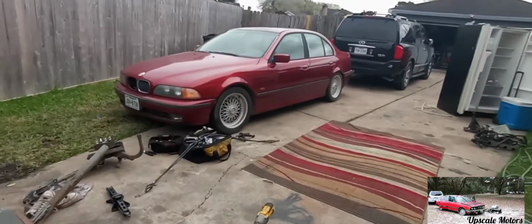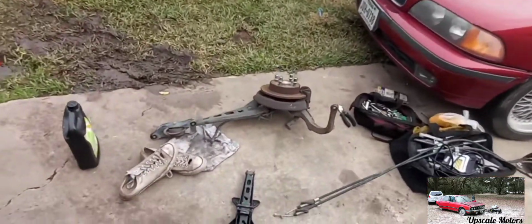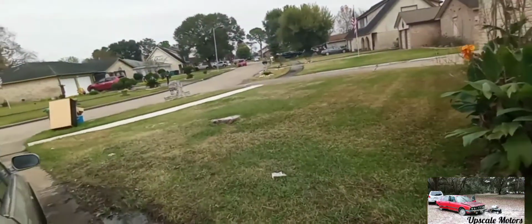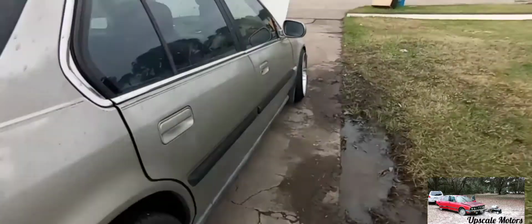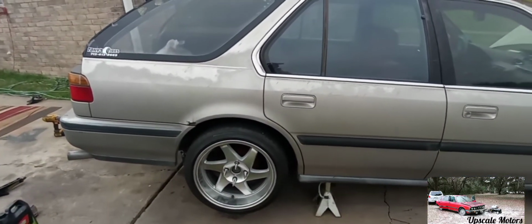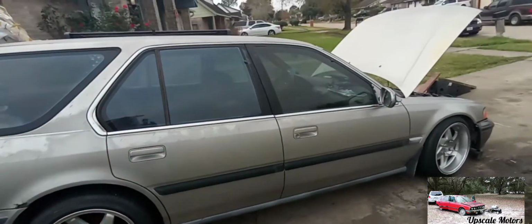All right, so I'm going to take the other rim off, which I still have on. I'm going to be using this jack to jack up the front with my impact. It's a 19 millimeter. Throw some nylon grease on there and go up with it. And pop this one off, and once I pop this one off, we'll start getting to the nitty-gritty.